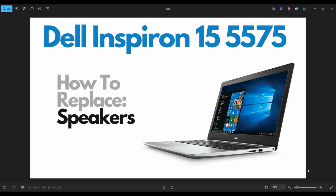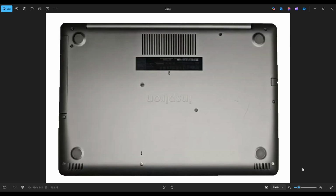In this video, I have a Dell Inspiron 15-5575. I'm going to show you how to get inside, access your speakers. So first thing, power down your computer through the start menu, make sure it's off and unplugged from your charger. We're then going to flip your computer over to access your bottom case screws.